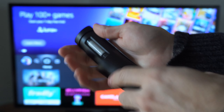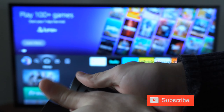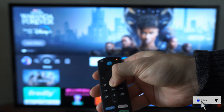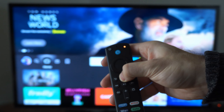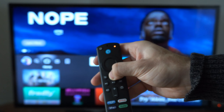The first thing we want to do is flip our remote around and take out the batteries, then simply plug them back in. Hold down the home button for about 15 to 20 seconds and your remote will start blinking green. It should be trying to connect to the Amazon Fire Stick.